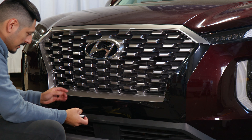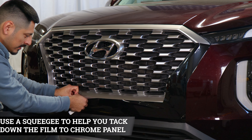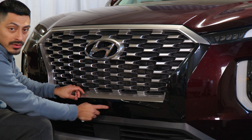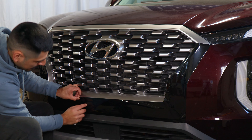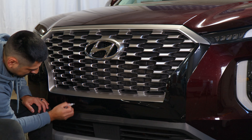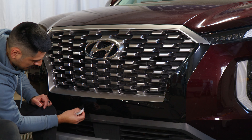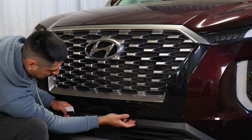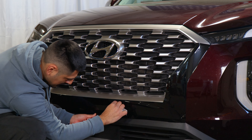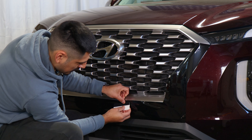Once you finish placing the film, grab your squeegee and start tacking everything down. If you have fingers, just lift the film carefully to help remove them and then squeegee. If you had license plates on the grille, you're going to have two holes right here in the center — just work those out, apply heat, and continue installing the rest of the film. Make sure the section where the license plate screws go is tacked down, with no air left over. If you need to lift the film to remove fingers, you can — that way we avoid creasing it. Lift carefully and tack down.